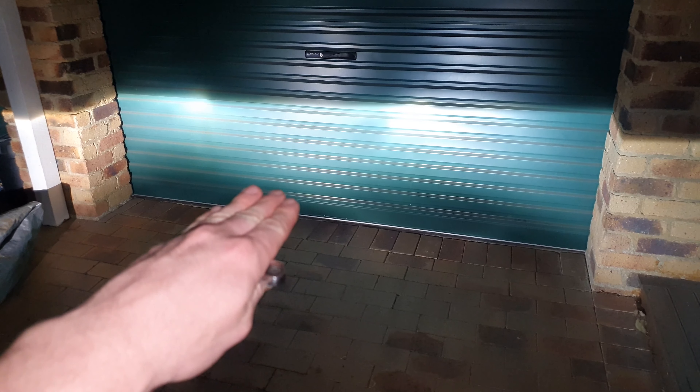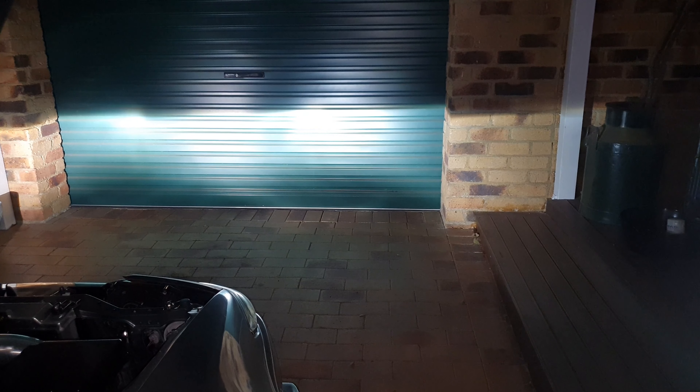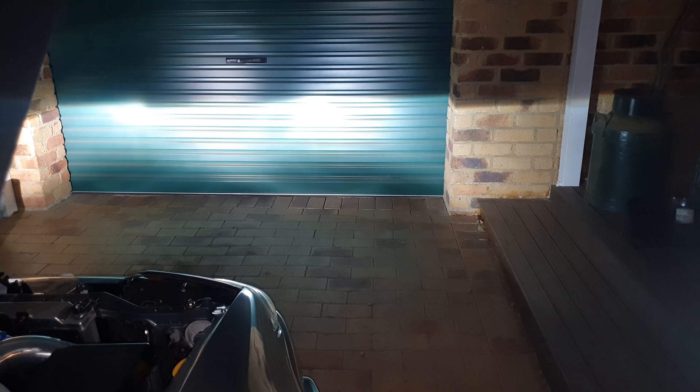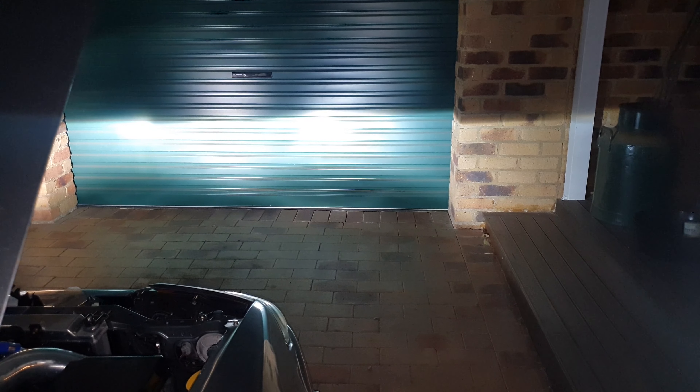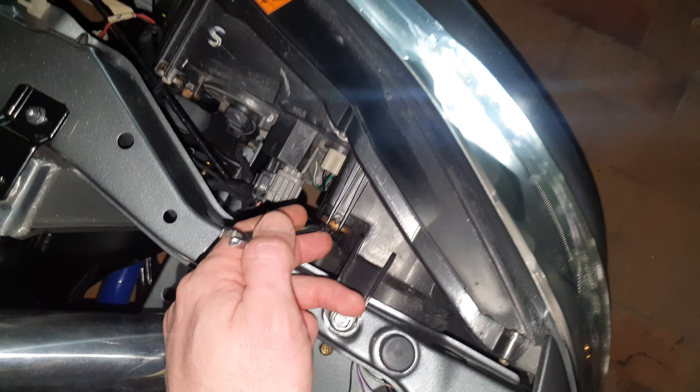At the moment the car is off to one side — it's not perfectly level. So this one is a little bit higher and I'm just going to consider that as normal — it's pretty flat. A quick demonstration of just the HID level adjustment in the car. I've got my hand on the switch. You probably heard the motor go. That's actually now lowering it. It's going up and that's maximum height. So we might start from the lower setting and just adjust those main beams a little bit more so they're just a little bit higher. This is the low beam side and I'm adjusting this for the height of the low beams. You can see that coming up, which is great — that's what we want.